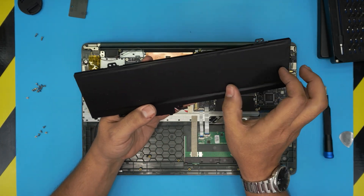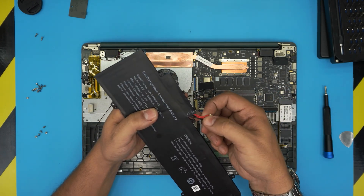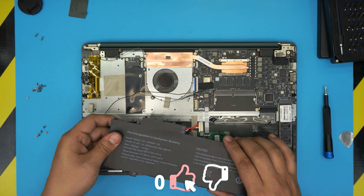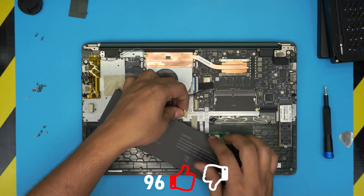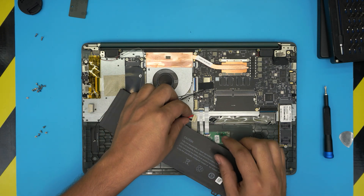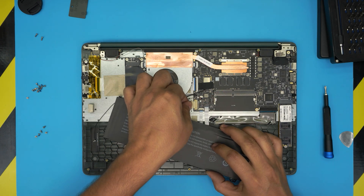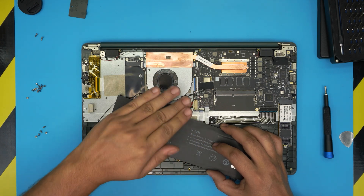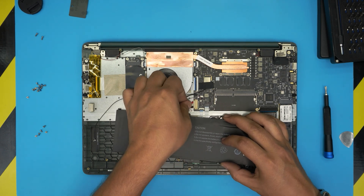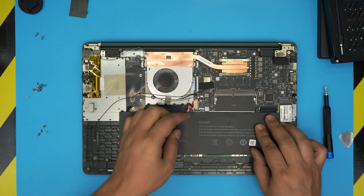There's your battery — there are actually three cell batteries inside, with three red and three black cables, one for each cell. When installing the new battery, put it in at an angle first. Make sure the positive — the red side — is facing the fan. Don't put it in the wrong way or you'll short it. Slide it in evenly all the way toward the jack, align the screw holes, and push it into the connector.